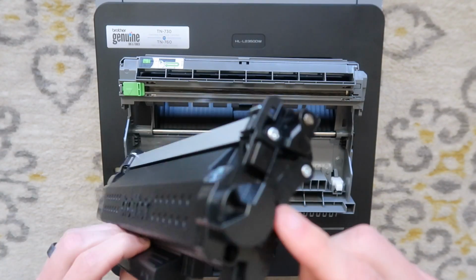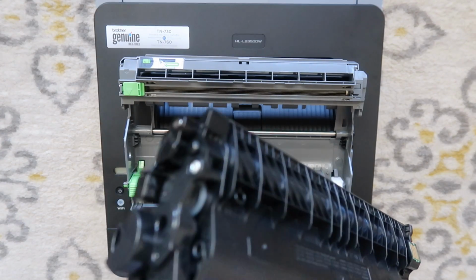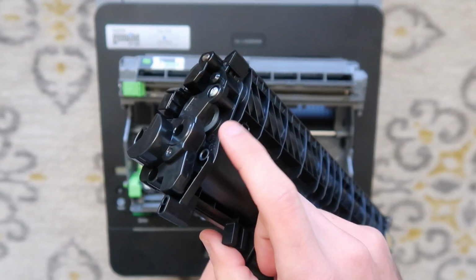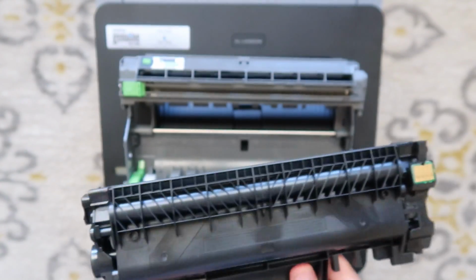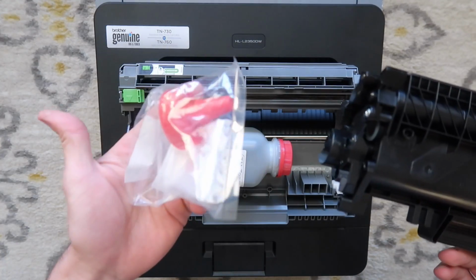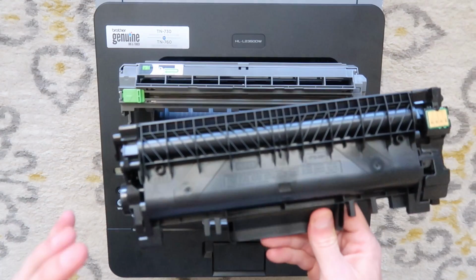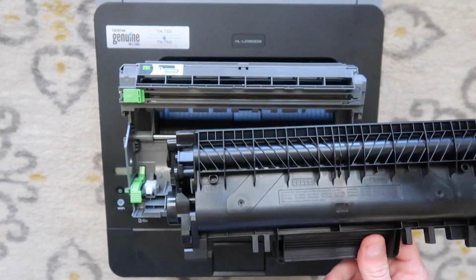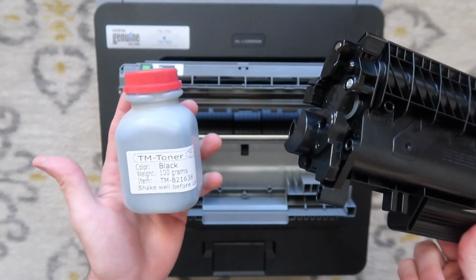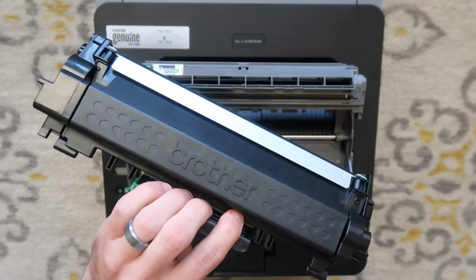By removing some plastic here, you can barely see, there you go, you can barely see this white cap right there. We're going to remove that, and we're going to fill it with a powder. You can buy these toner refill kits that have squeeze bottles to squeeze some toner into your cartridge, and that's exactly what I'm going to do. I will put a link to this in the description. I got it off Amazon. I think it was like $7 or $8. Highly encouraged to learn about toner refills rather than buying the cartridges.